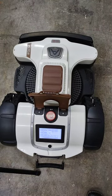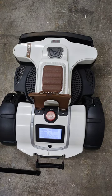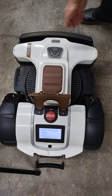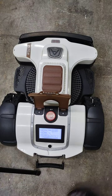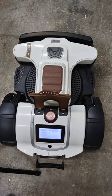For the lift test, the way it works on these robots is by the front wheels dropping down to determine that the robot is lifted. There's also an inclinometer on the motherboard. But effectively, this lift test is verifying that the front wheels are dropping down just fine. You can see how they lit up. Now for the inclinometer, we do have a plus two degrees — that's probably because this location is not completely flat. If it was plus 30 degrees or something astronomical like that, then that would mean you would need to recalibrate the inclinometer on the motherboard.